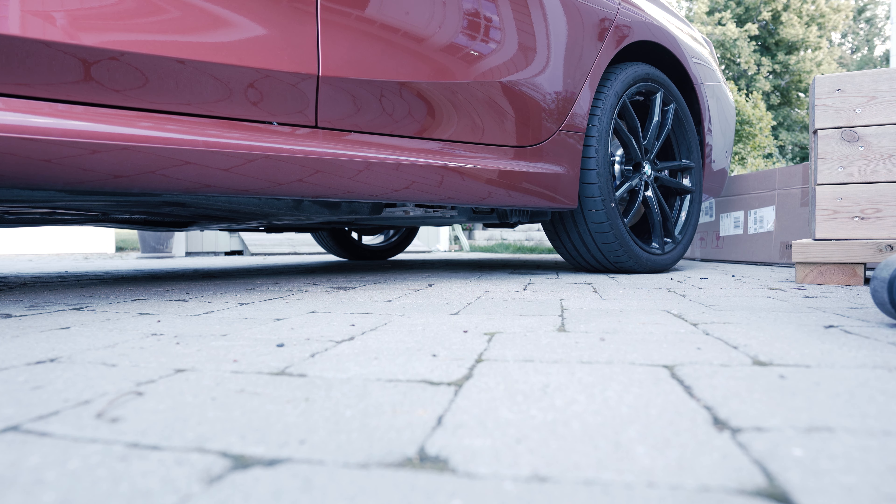For the centerpiece, we have a splash guard here — I'll gently pull that downwards and then position these tabs underneath it. Once everything seems to be in place, give it a push and hopefully it will seat correctly. I found it easier to pull down the splash guard, put my fingers behind the diffuser, and press from that side — and actually it clicks into place and sits really tight. Finally, we'll put back the screws which we removed in the first step.